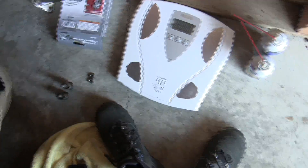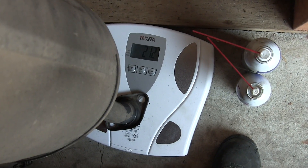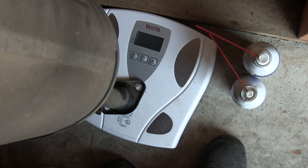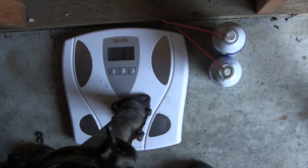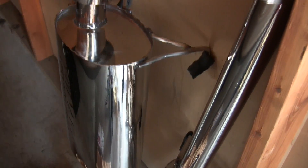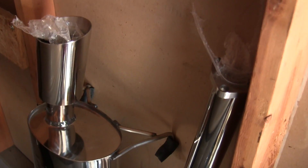So the big question — which is heavier? The Yonaka has a wider pipe so you'd imagine it may be heavier, but the old muffler came in at 21.2 pounds — actually quite a bit heavier than the Yonaka exhaust, probably filled up with quite a bit of carbon and other stuff over the years. The remaining exhaust piece — the resonator and mid-pipe — weighed 16.4 pounds. So overall the stock exhaust was about 9.8 pounds heavier. It's pretty exciting to not only increase the diameter of the piping but also reduce about 10 pounds while we're at it.